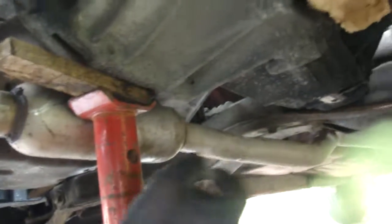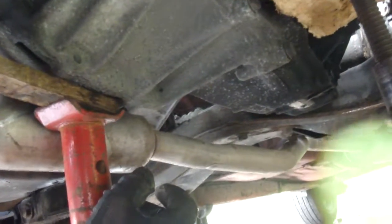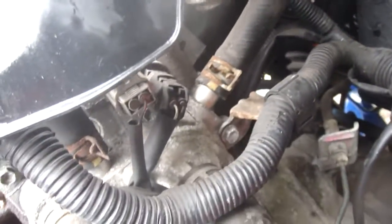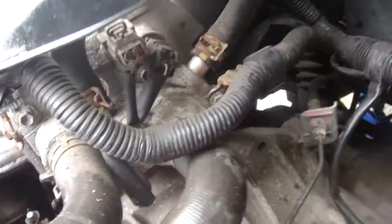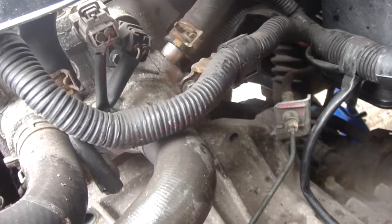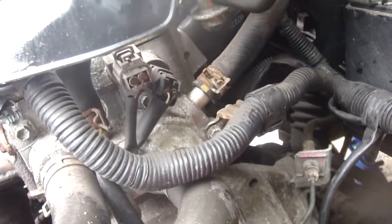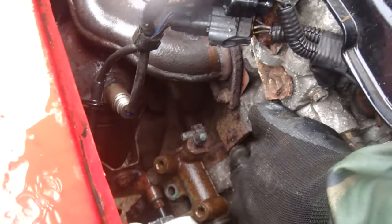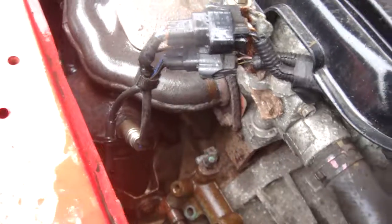I don't think the battery is going to give me much more on the camera. The next time you join me we will be removing the gearbox. I want to charge the camera up a bit and remove those two bolts. Once that's done, this gearbox is ready to remove. What will happen is I'll undo those two bolts and because it's all supported and steady nothing will happen, then I'll just stick a bar in between the casting of the engine and the casting of the gearbox and prise it off - you'll see it just pop off.